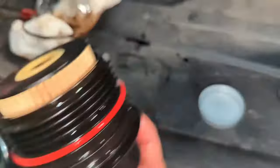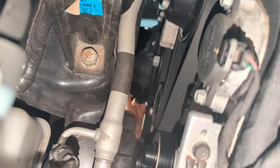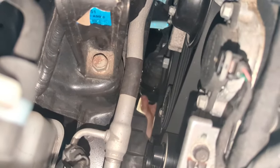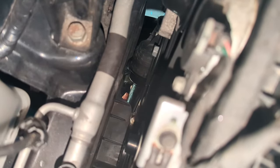Now we just have to screw this back into its casing. Put the filter back in the canister and turn it clockwise. Turn it snug — the torque rating is 28 Newton meters — nice and tight until you crush the washer a little bit, but not too much.